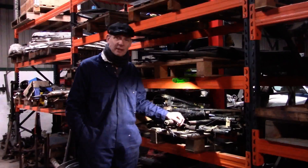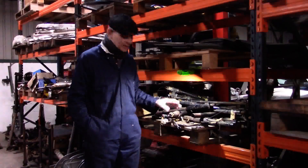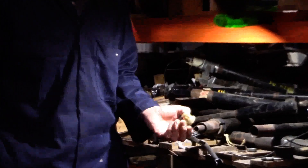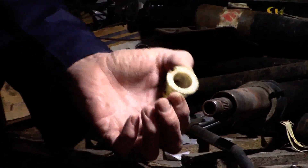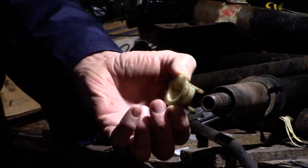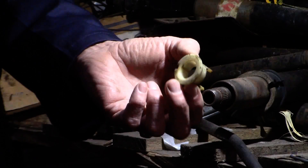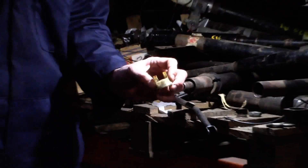Let's look at some of the suggestions that have come in in just the last 24 hours. Here's a really good one — this here is a steering column from the Amazon. Later ones had a cancelling collar made of plastic; earlier had metal ones, but the plastic one will directly replace it. I get asked for this every so often because people somehow miss it off when fitting an aftermarket steering wheel, and then the whole steering becomes rattly and sloppy. So there's a good one — the cancelling collar on the steering column.